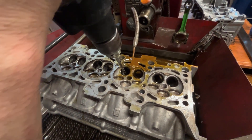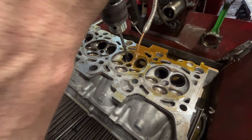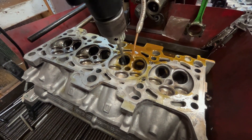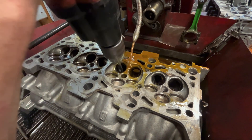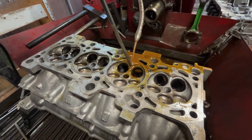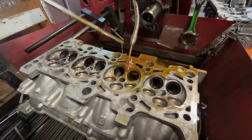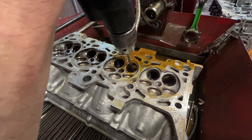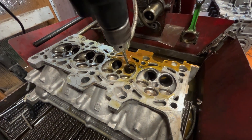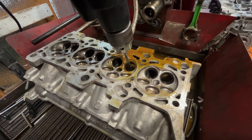What we're going to do is lightly guide this into the valve guide — feel the angle you're at. That's all you're going to need to do. We'll rinse off the flutes to get the bronze off. I'm going to line it in nice and easy. The reason this is nice is that the pilot is a little longer than the alternate reamers, giving you more stability when you are doing this procedure.